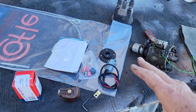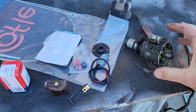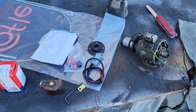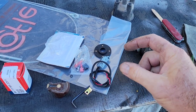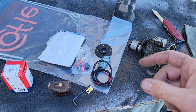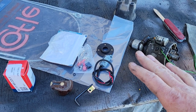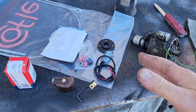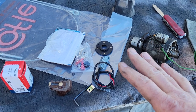Do not — there are distributors that come in a white box, and they're not Ampy ones. They don't have this module in them. There are also companies that sell cheap $15 or $20 ignition modules that come in a white box, and they sell them at a lot of parts stores. Those suckers are so unreliable. Do not run one of those — you will just be wasting your time. You'll be changing it all the time and it might not even work when you first put it on. We call those the white box pointless. Don't buy the white box pointless — they're junk.